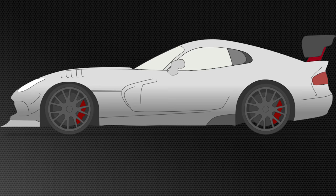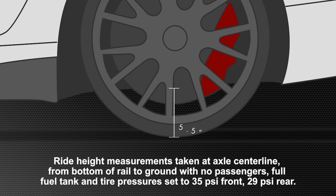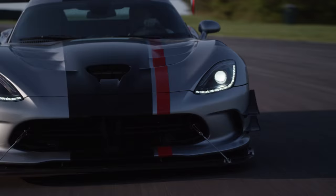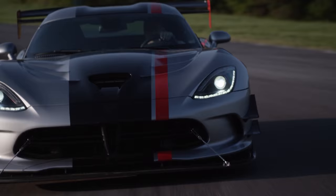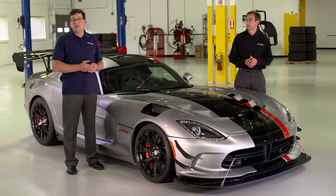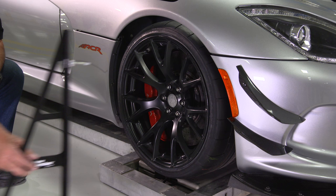We recommend you start with a front ride height of 4.0 inches and a rear ride height of 5.5 inches. This will give you a good baseline amount of rake and sufficient shock travel. Then we'll check the corner balance on scales to within 10 pounds of cross axle weight to ensure symmetric handling. Make sure the sway bar is disconnected before these adjustments and reconnect it when done, then recheck the corner weights and frame height.